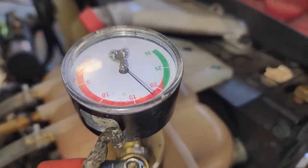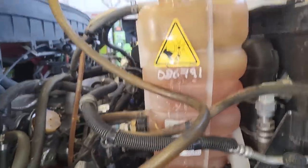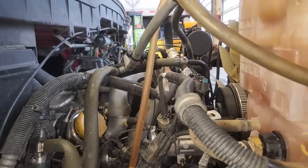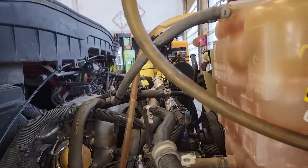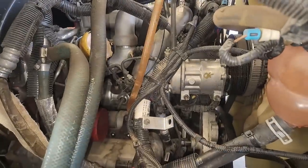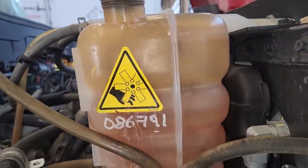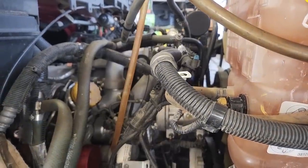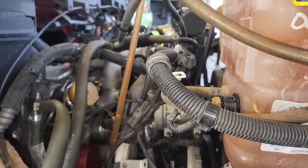What we're looking for is air bubbles, which are lighter than coolant or water. So what we're doing is pulling a vacuum, and if you keep getting air out of the EGR cooler, there's really only one way that's getting in - through either the exhaust or the intake side of the cooler and into the cooling system. It can't come through the head because the head is above the EGR cooler. At this point, basically we know the EGR cooler has to be removed and tested and that it is destroyed.